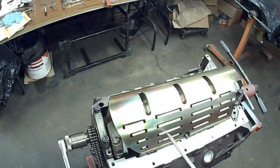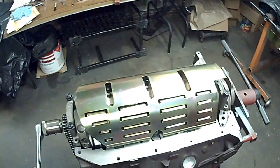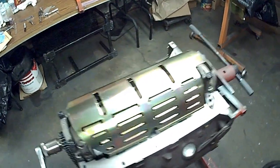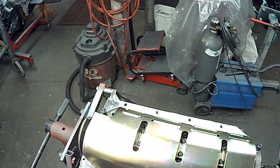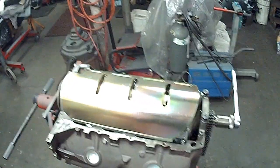The two items will basically keep a lot of the oil down into the pan, get rid of all that flying oil, adds about 15 horsepower, and the oil control is the best deal. I developed this pan so it would work on everything — stock blocks, the IA, and the MR1.